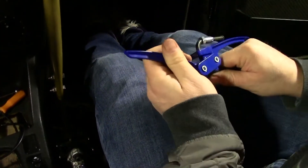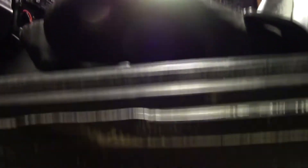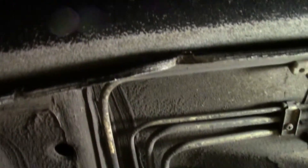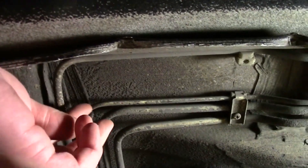Look, we made a puzzle. We've got a couple of bends in and it turns out running the lines just in front of the e-brake and straight down next to the seat is a near perfect place to join into the brake line. You can see right here — if I go straight down, there are the brake lines. There is the brake line; it's the small one next to all the fuel lines.